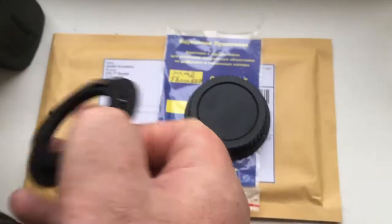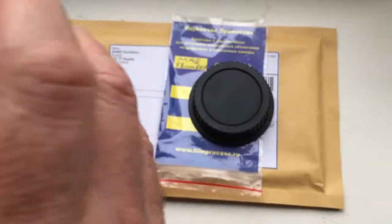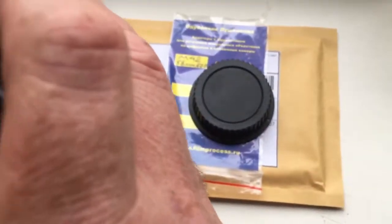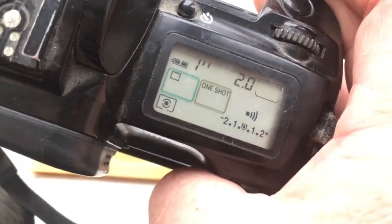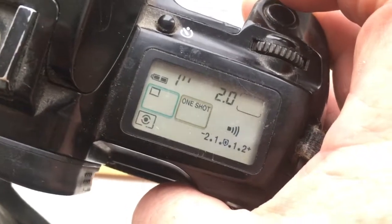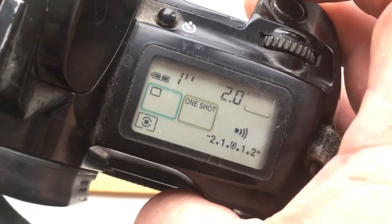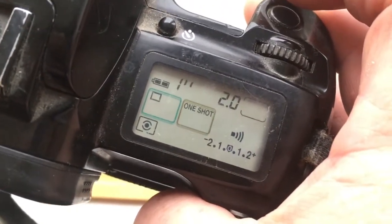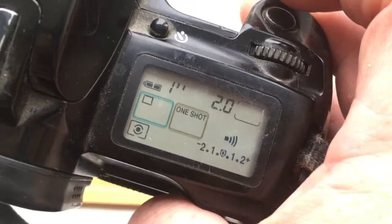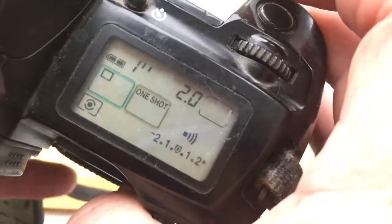Look. I pre-programmed focal length 58mm and aperture 2.0. Delay time to enter programmer mode is 1 second. You can always reprogram the chip from our programming instruction, but it is better to reprogram the chip on the digital camera.